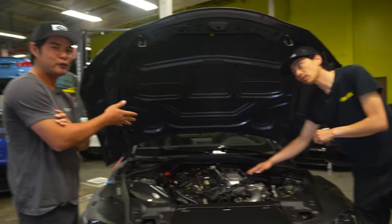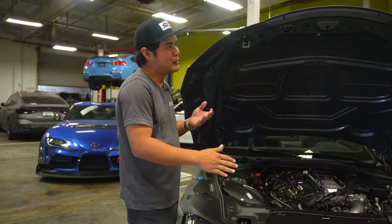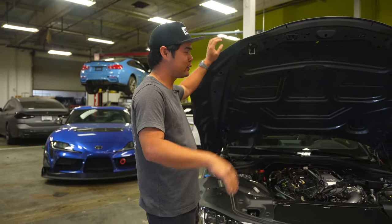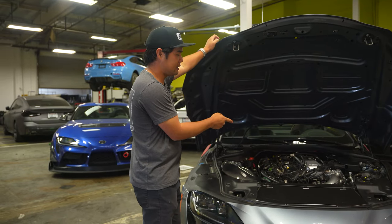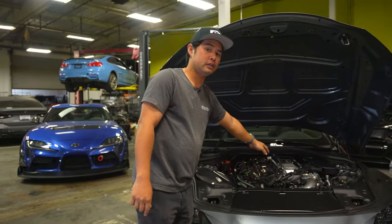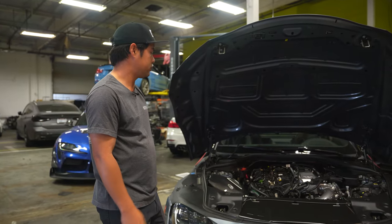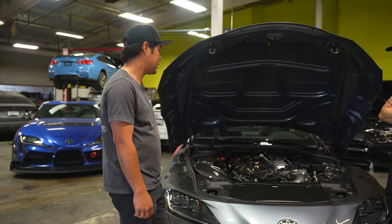Yeah. And then also too, guys, I had to stop Larry from going full big turbo real quick, straight from stage one to like stage 4.5 or whatever you want to call it. But the good thing about the CSF manifold is that it's going to be cooling it for whatever stage you're at, but it's also already pre-set up for the port injection. So right now, even though we don't have port injection in it, it's all ready to go. All we have to do is buy the injectors, get the controller, and throw it on there, and then flash a new tune in it.